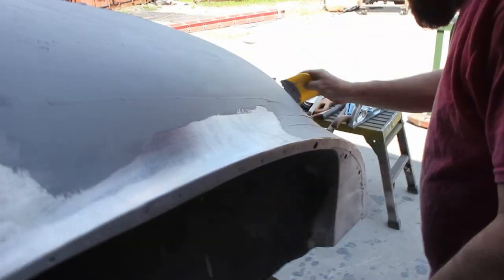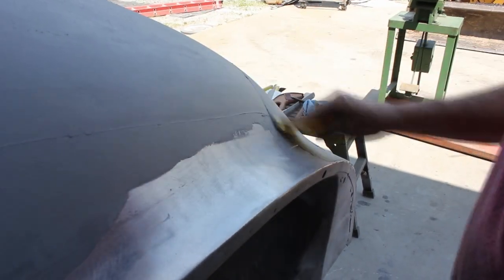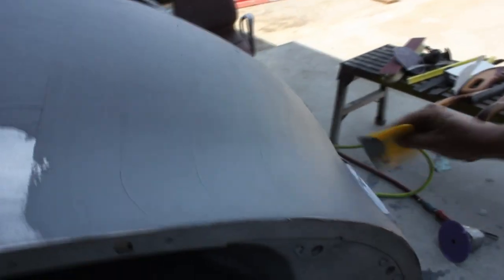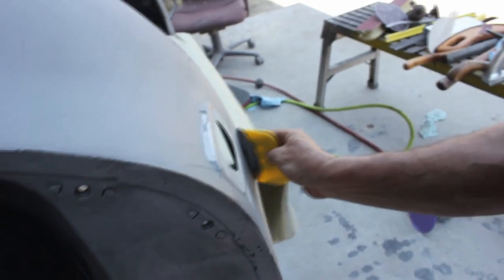For everybody that's watching out there, this is not a normal body filler. This is actually a lead replacement — it's a two-part, three-to-one mix of an epoxy binder. It really reacts and behaves in a lot of the same ways as lead, and you don't have to deal with as many of the acids. A few other shops doing top-end restorations in the country are using the same product, but it is not cheap — it's a very expensive product. But these cars are very expensive when you're done and you have a lot of time in them, so you try to use the best product you can on a person's car when they've invested a lot of money into a vehicle.